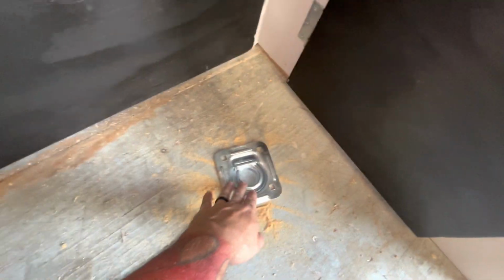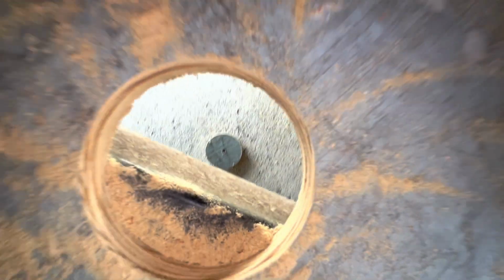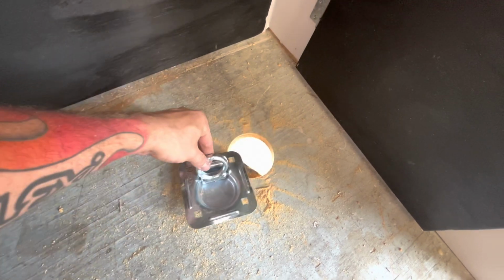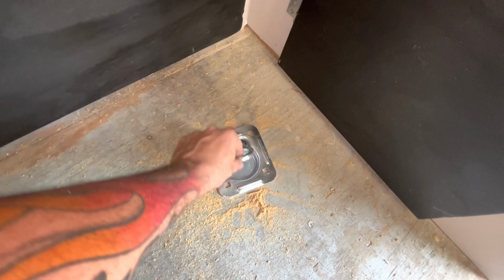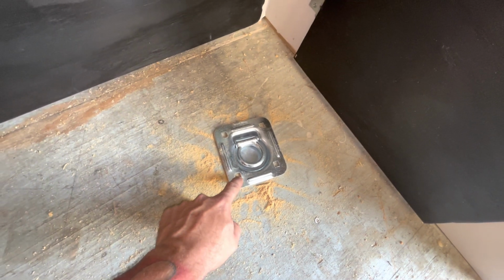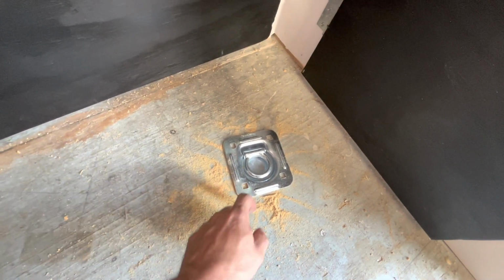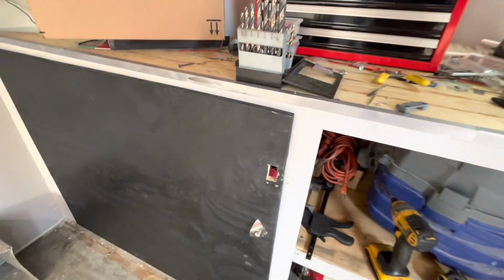Also went ahead and drilled a tie down in the corner, and of course I didn't really plan it out. Metal beam right there. If I would have been that way just a little bit more, it would have worked fine, but of course that's my luck. I kind of wanted it at a 45 a little bit anyway, so we're going to put it like that so we can get 3 bolts through the plywood with some big washers so that it clears that. I think this one I might drill, and then drill on the bottom, and I'll probably have to order a really long bolt, because I bet the hardware store won't have it, and then put this one all the way through the main frame of the trailer and do another one on the other side.